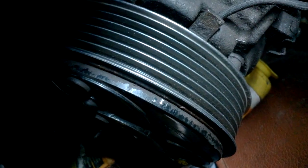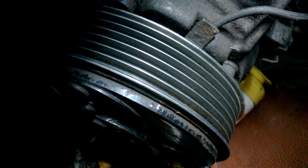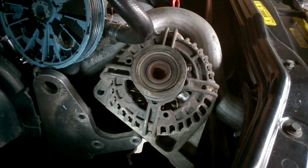This gap makes more sense to me. You may want to measure it — I don't have the exact numbers, just know by feeling, and it sounds good to me. But each case is different so you may want to check which shims to remove. I had quite a hard time removing the clutch the second time — I think it's because I put grease on the place where the clutch slides in, so perhaps it's a better idea not to put grease on it.